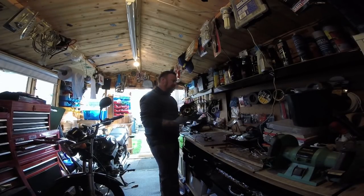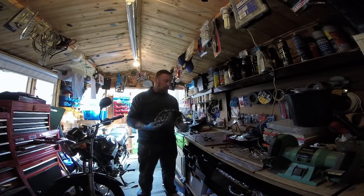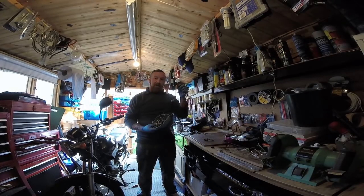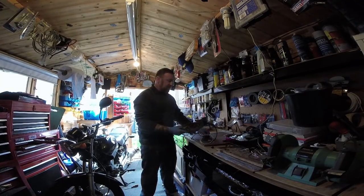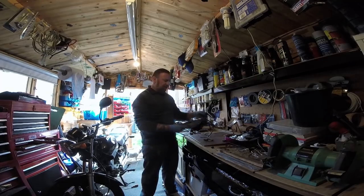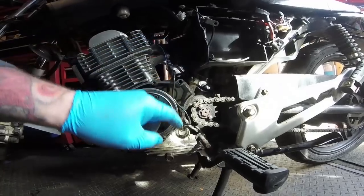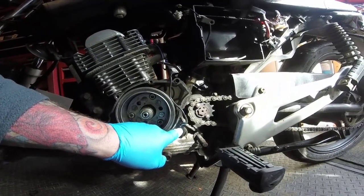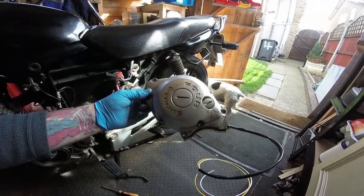So, figuring out the wires, these are yellow and white. There's a blue wire and there's a timing pickup. Remember I've said to you, stator coils do two things. This does electrics and that is for your timing. Got to figure out there. On the bike, however, I had a blue wire and I figured it went here. And on the casing, there's a little slip for it, I reckon. So, that's where it's going.